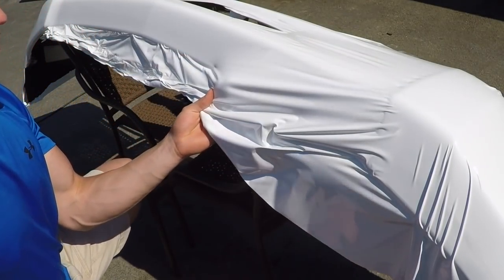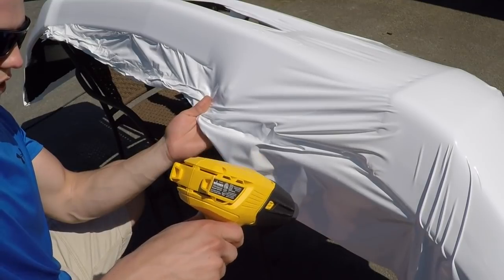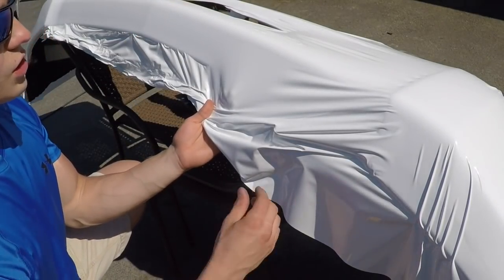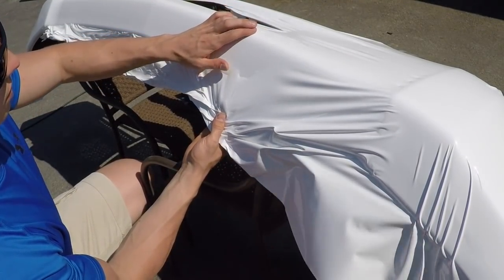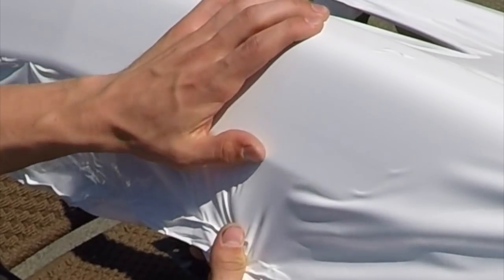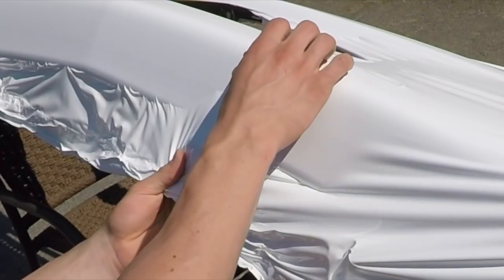The technique here: pull the vinyl up so you're only touching where you've already applied it, give a little bit of heat — but don't just sit there too long or you'll heat the vinyl too much and tear it. Work your way from the back and down. If you just throw it over you'll get air bubbles everywhere, so keep it up, work your way down and in so all the air comes out the bottom. If you get an air bubble, pull it up a little until the air escapes, then work your way back down.